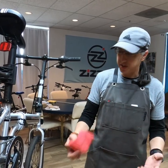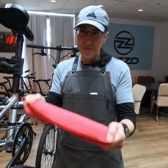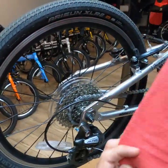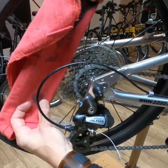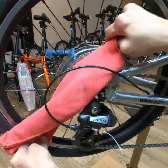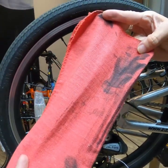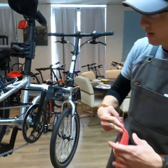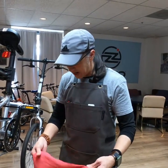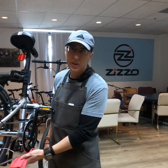If you have a dirty drivetrain, since you've already got your rag, you can take that folded rag and floss it between the cogs. Then pedal backwards to clean in between the cogs — you can see how much grease you pull out from in there. Again, this isn't a complete drivetrain cleaning where you're taking parts off. This is just a quick 15-minute job if you haven't done any maintenance on your chain — you can just quickly lube it up.